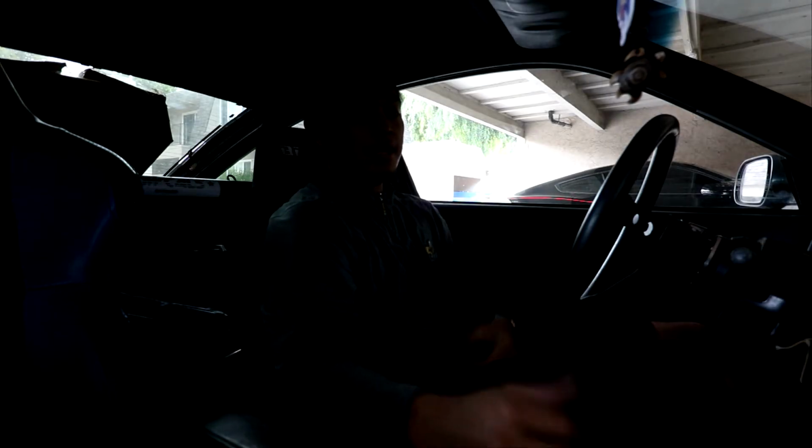Everything's back on, like I said. Time to test drive this. Hopefully everything works out fine. If not, GG. I'm gonna let the car warm up real quick for a good 10-15 minutes, and then I'm gonna go drive it. See if it drives well. If it doesn't, I don't know what's gonna happen. I'm probably just gonna go mess with the TPS sensor, because it's either the TPS, timing, or the MAF. But I cleaned the mass airflow sensor, so I don't think it's the mass airflow sensor. And I also got a new air filter, so it might be the TPS.